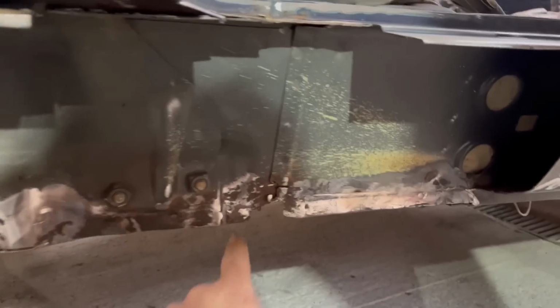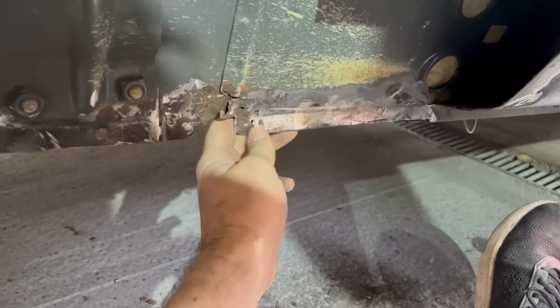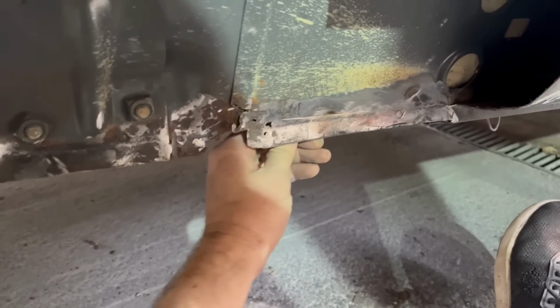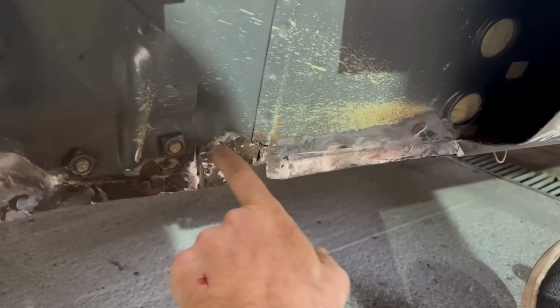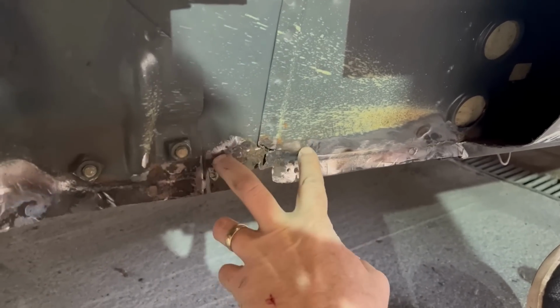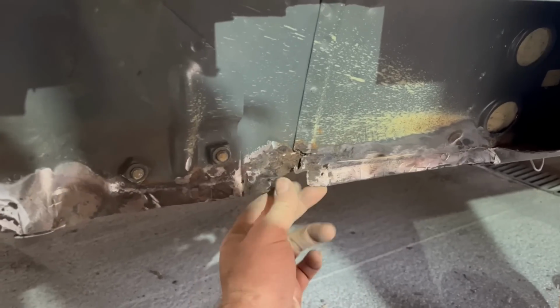What killed the grinder was trying to cut through this, because it looked frilly and I thought, oh, I better replace it while I'm here. But it's really thick, tough metal, and the grinder didn't like it. So, the plan is just cut a little rectangle, put a piece of 1.5 mil in there, or 1.2. Nothing complicated, and then the sill goes on top.